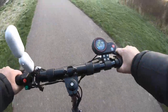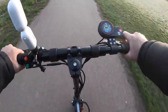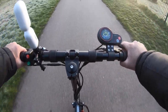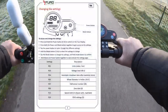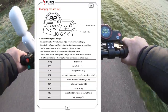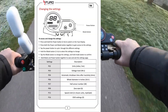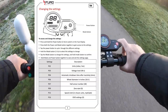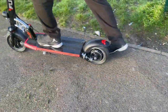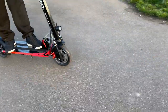Talking about power, you have a 750 watt motor and this scooter can reach speeds of up to 40 kilometers per hour. By default the maximum speed I could achieve was around 30 to 32 kilometers per hour, which felt pretty fast. But if you want to unlock the top speed, whip out the manual and you will see a page on how to access a secret menu by holding down the power button and the mode button for a few seconds. You'll be able to tweak hidden settings including units, kilometers or miles, voltage levels, and speed limits which can be increased or decreased to match your country's regulations, or maxed to the top speed of 40 kilometers per hour. This scooter also promises a range of up to 55 kilometers and takes around 5.5 hours to fully charge the battery.